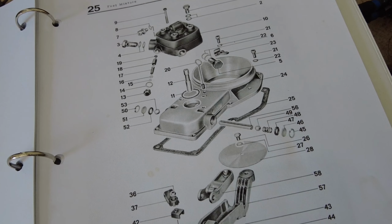Yeah, there it is. All of the fittings are off there. Now I just have to undo that screw, and that screw. And that thing should pop off of there. Should. Famous last words. This is where the pressure regulator is, right in there. So I'll see if I can get that out. And I'll try and make sure that I don't lose that pin when I'm pulling it out of there, because the pin will drop out. Perhaps. We'll see. Yeah, there it is.